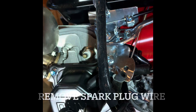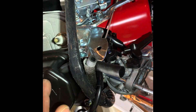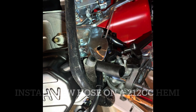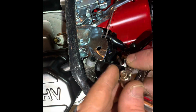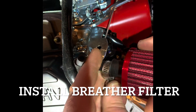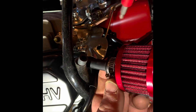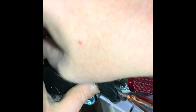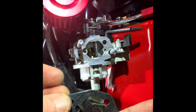I removed the spark plug wire. On the hemi version of the 212, the hose runs to the exterior of the valve cover and you'd use the supplied new hose, but you don't even have to on that model. On this 224, the hose runs directly in, so I'm not going to need it anyway. I'm going to put my breather filter on top with the hose clamp and clamp it down, then plug the spark plug back in. Remove the old gasket and replace it with the new one.